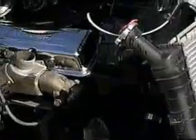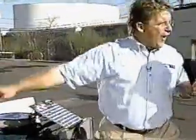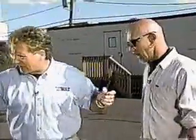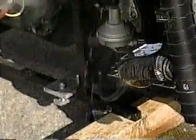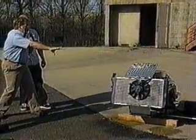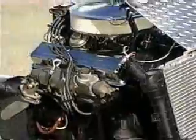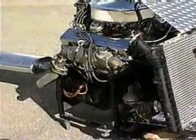So if this happens... we're smoking. Smoking. Steaming. Look at this — soaked. You're losing water. Your engine is spewing. You're already having problems. We're over 240 degrees. Look down here too — the lower hose is starting to swell. The radiator cap wants to blow. The engine is struggling. You can see it — it continues to lose fluid.